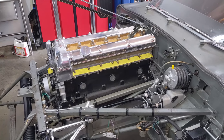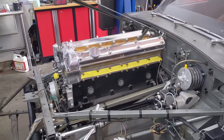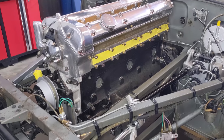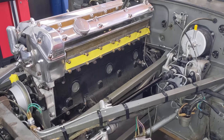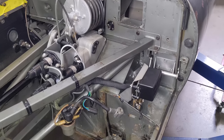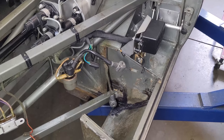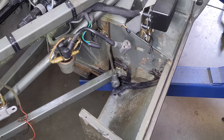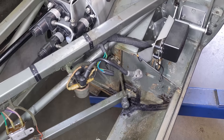We've got a few things to put in before this engine's running. Really have attached nothing since it got installed aside from the mounts, so there's a lot of systems to put in. Just going to do a tour. This is where the heater box will sit and the battery as well. I put some rust converter down in there and I'm going to have to paint some gray paint in there — just found a slight bit of surface corrosion from the battery area. That's pretty common.